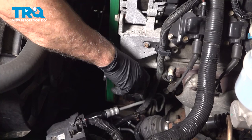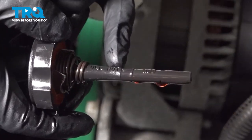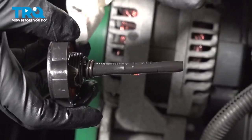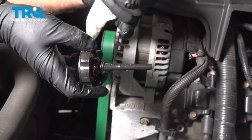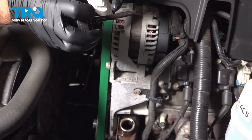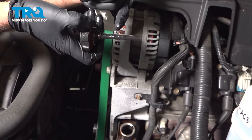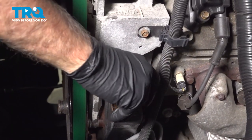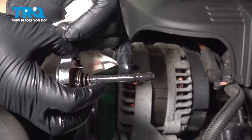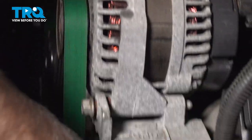We repeated that procedure and checked it again — the fluid level's right at the top, which is good. We're gonna start the vehicle and turn the wheel back and forth, stop to stop again with the wheels still up in the air, shut it down and recheck it. It should be close to in between the two lines, either cold or hot. I removed some fluid, checked it again, and it's right about there — which is perfect. Then just seal it up.